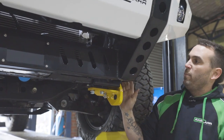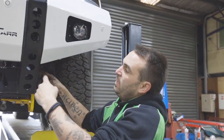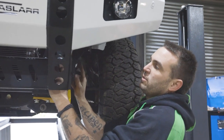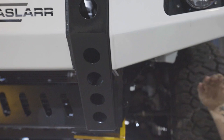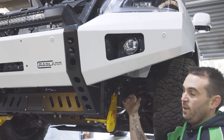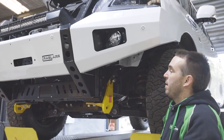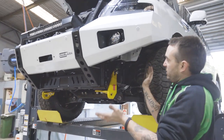Now, the most important bolt that everyone misses, this main pin that's going through the rail has a thread that's 90 degrees through it. So there's actually a long bolt up through the inside that ties through. So if you look, when this moves, the main pin moves because it's through the whole lot. So the trick is to get your torch in where Adam is, line your thread up by turning this back and forth till you're nice and level and feeding your bolt through. It is quite tedious, but it's a very critical bolt to have because it makes them interlock from every different angle.